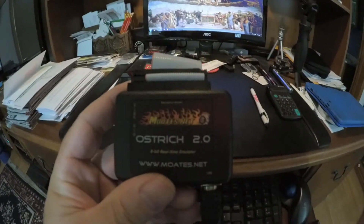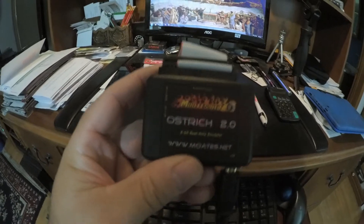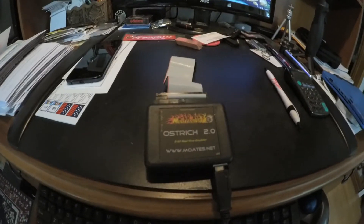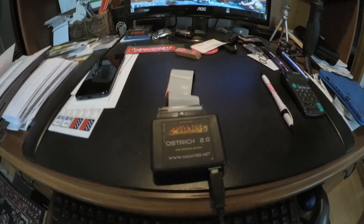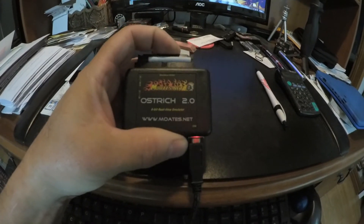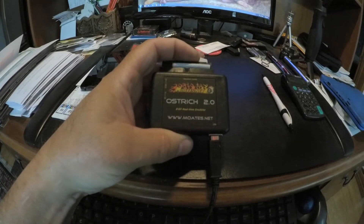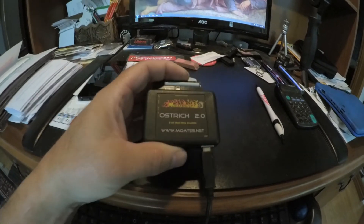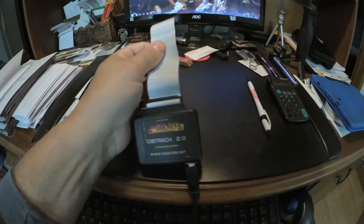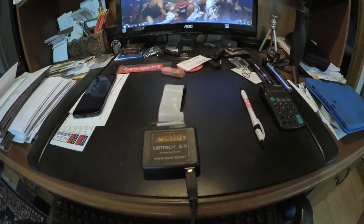I know there are people that just run these all the time, and that's probably fine if your ECM is inside the car. These things are not waterproof, so if you have like a 90 or 91 Corvette like mine where the ECM is located under the hood and exposed to heat, weather, and vibration, that's probably not a good idea. On my 90 Corvette, I have issues with EMI — electromagnetic interference — because the ECM is under the hood. Run the shortest cable possible to help eliminate that. I know some people wrap these in aluminum; maybe I'll try that next time.